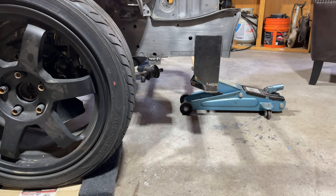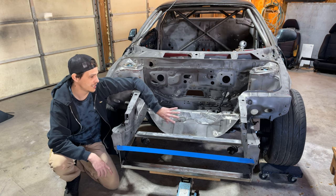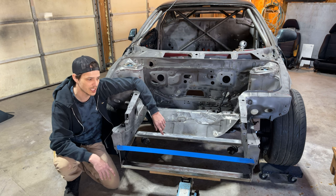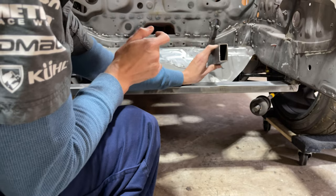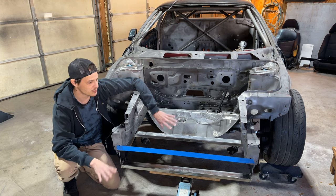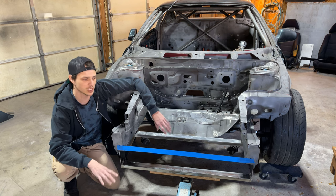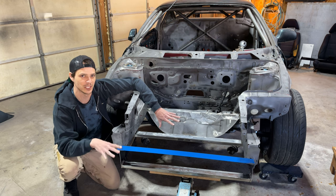We also took some time to make the front radiator support, but all this stuff gave us the opportunity to add some new tricks to this front end. We're going to be able to run an updated suspension and a newer MR2-style suspension. Now with our core support being so structurally sound, we can actually attach some of our front aero to this guy — and it's going to be really nice being able to use that tied into the actual frame rails of the vehicle, rather than just being tied into a bumper or some other piece of the car that's not really tied into the chassis.